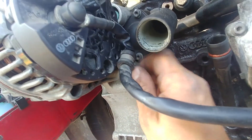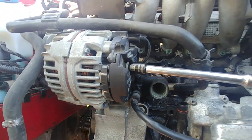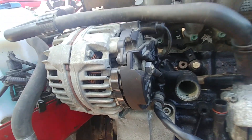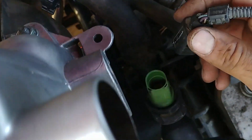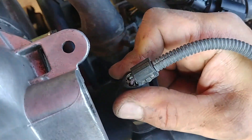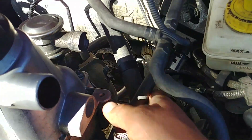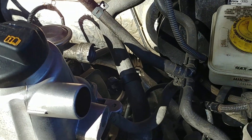Another bolt, another nut — the starter. Tie everything down. There's the coolant temperature sensor — connect that. You still have a bunch of connectors to put back, including the coolant line for the throttle body.